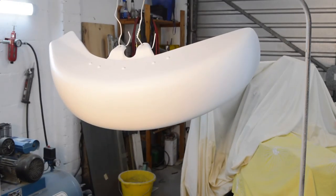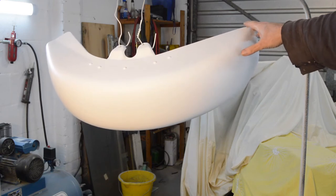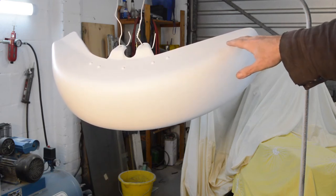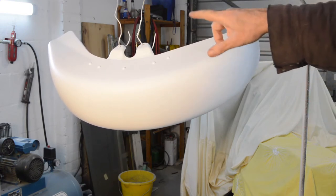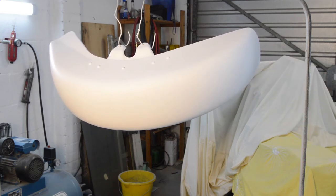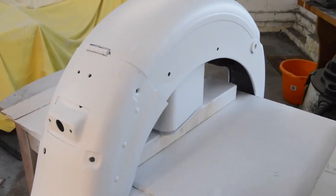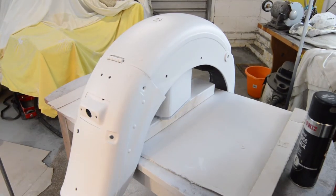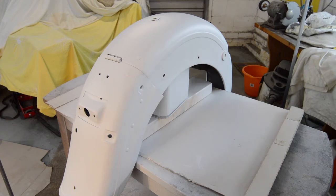That's the primer coat on — it's actually three coats of high-build primer. I've now got to rub it down. I can still see the pressing lines in the primer; hopefully that will have gone by the time I finish flatting it. Moving on, I can see some very minor imperfections that I haven't addressed with the filling, but they are minor, so it's the surface I really need to address now.